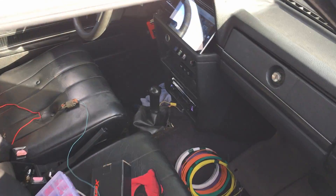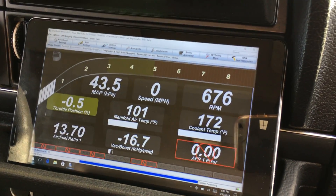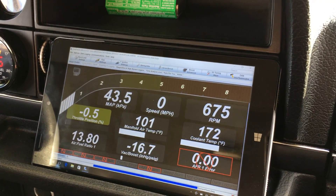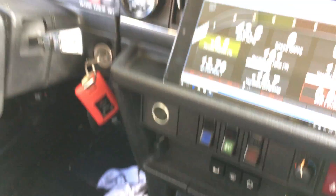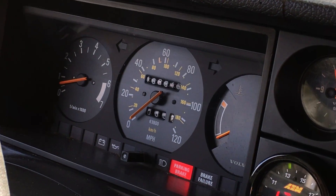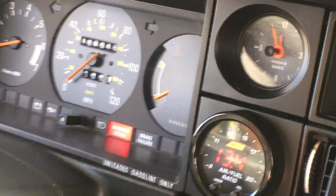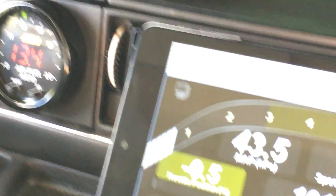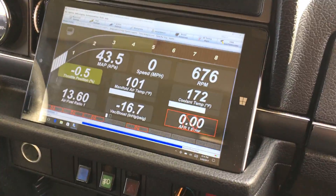There's the inside of the car. There's Micro Squirt. I'm going to have to bump up the idle a little bit — I want it to be at 750. There's the 5-speed. We got the tach working. This guy works; he doesn't work yet — that's just temperature, I thought those were more pressure. I'm monitoring my temperatures here — 172. It's wonderful.